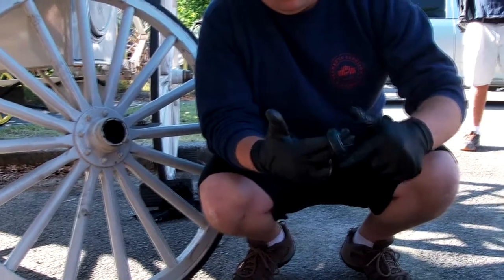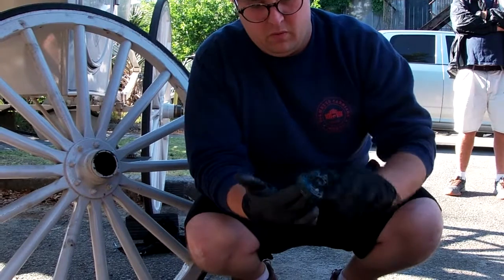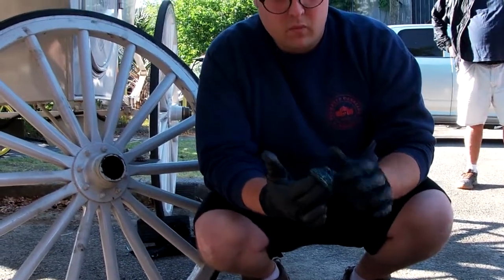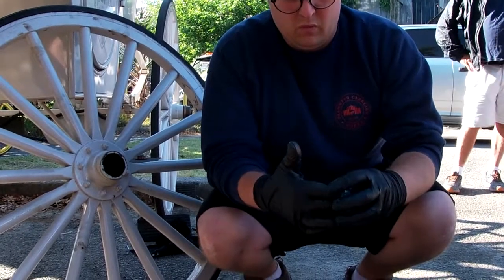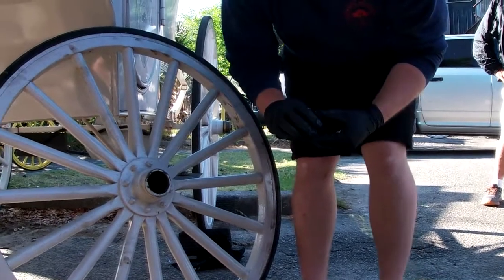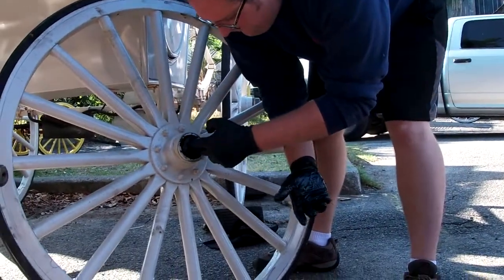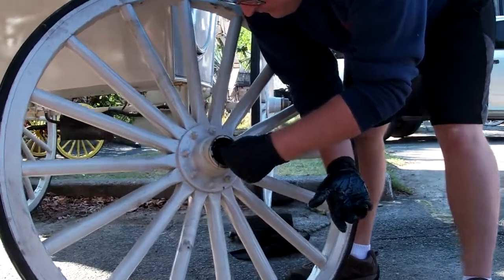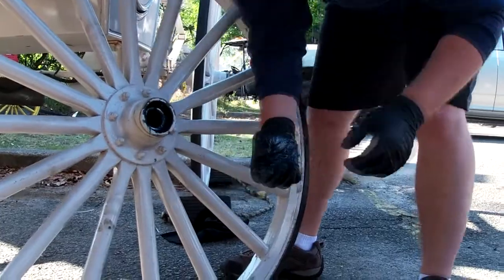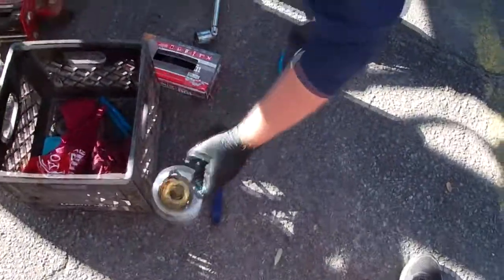But don't think just because that bearing won't come out, that seal actually holds that bearing in there, keeps it from coming out. Some of them may not have that seal. I know none of the bigs do. When you pull that wheel off, that inner bearing is going to come right out with it. So he's got the inner bearing done. Now he's going to pop that seal right back in there, and all you do is drive it back in. It can be flush with the hub, the outer portion of that hub, and it's in far enough.